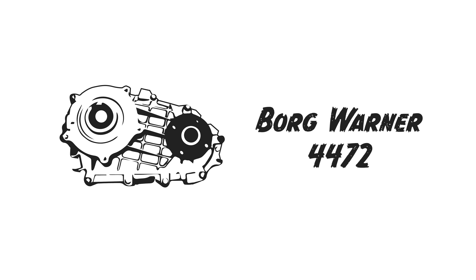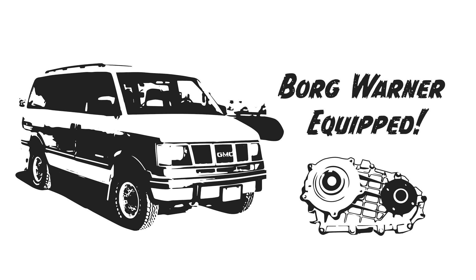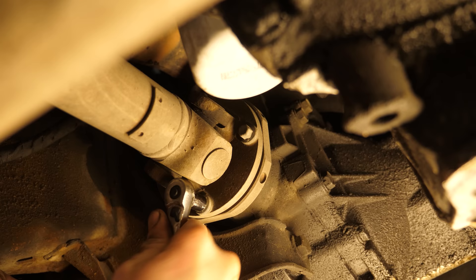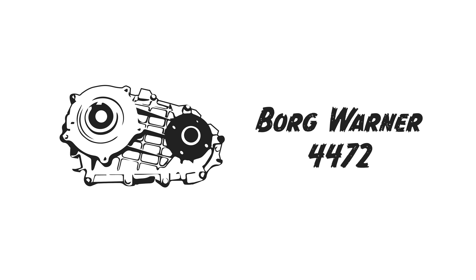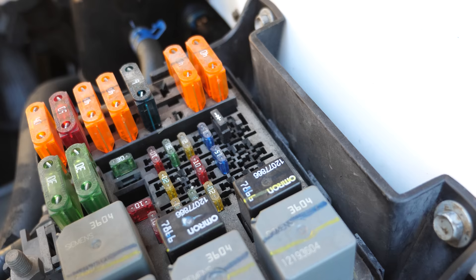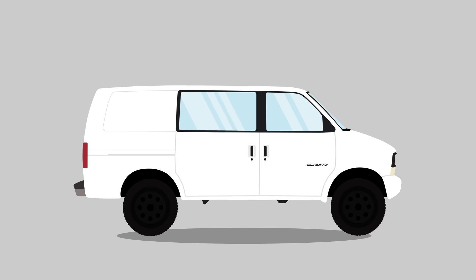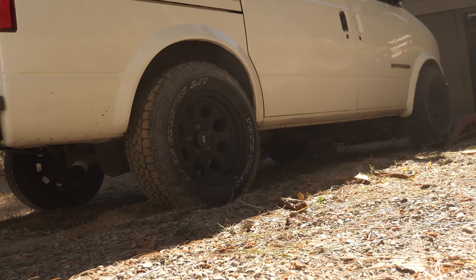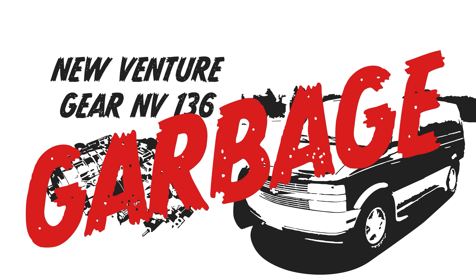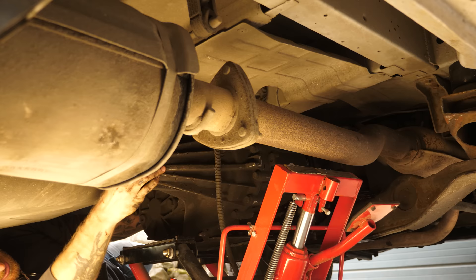there are generally two main transfer case types that were used at different times. One is called a Borg Warner 4472 transfer case and one is called a New Venture Gear NV136. The Borg Warners are on the earlier vans up until about 1997-1998 and they're generally a good transfer case — always engaged in all-wheel drive, making this option great for snow driving, kind of like a Subaru. But to put this transfer case into Scruffy would require us to change drive shafts, and the internal parts are starting to become obsolete, so this solution wasn't for me. The NV136 transfer case is on vans from 1999 to 2005, which unfortunately is on our van. This transfer case is not all-time all-wheel drive and is instead electronically controlled, meaning the controlling computer needs to detect a loss of traction at the rear wheels before engaging the front — which to me, I don't want to lose traction before I have all-wheel drive. This system is widely regarded to be garbage, riddled with mechanical and electronic issues, so this entire all-wheel drive system is what we'll be replacing today.